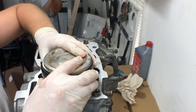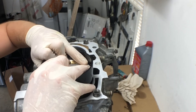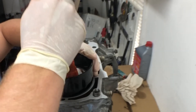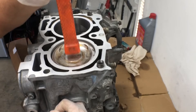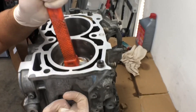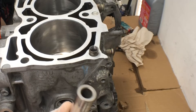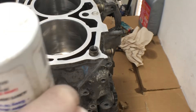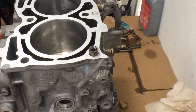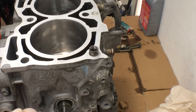Dropping the piston down the hole — it feels like it's going down. I think it might be going sideways. Got my finger in here; I'm going to try and feel the piston coming down. There it goes, I can feel it coming down and onto the rods. It actually moved pretty easy. We cleaned the piston with the wrist pin, a little bit of assembly lube on the wrist pins and crank pins, but not on the oil rings or cylinder walls or piston skirts.